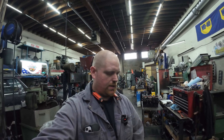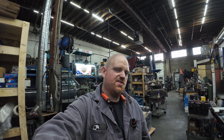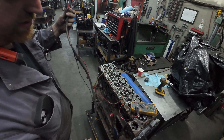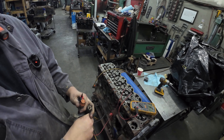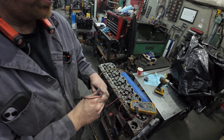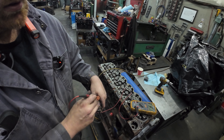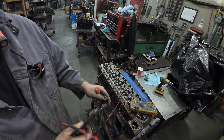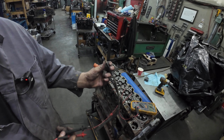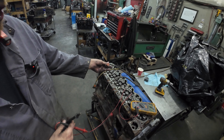If it's a short cord and you can get it out easily, you can test the cord the same way. Just go across and test one wire at a time. If you don't know which is which, it's not a big deal — you go across and find out which one works and which one doesn't. You can also check the ground wire, which is actually a good idea — you want the ground to be working too. So that tells you the cord is good. But most of the time you're going to have to unplug it to find that out.